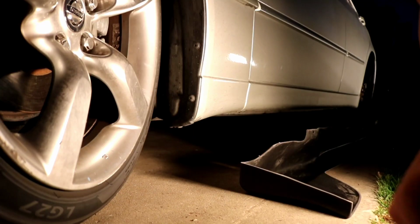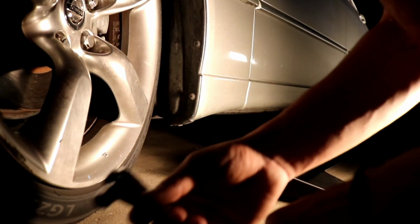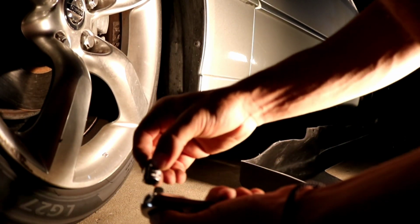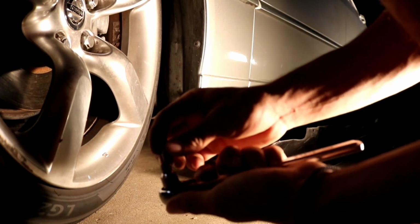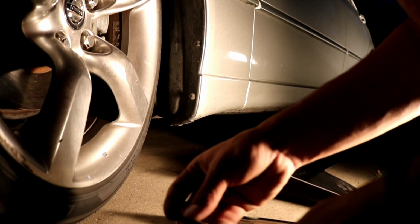It seems really simple. Right here in the front fender arch, there are going to be 3 Phillips head screws, and I think there's one in the bottom that I'm going to remove in a kind of hack style. I'm going to get my ratchet, get a 7mm socket, throw it on like that, put the little adapter piece with a screwdriver, and then just take it off like that. I know it's kind of ghetto, but I'm pretty sure it's going to get the job done.